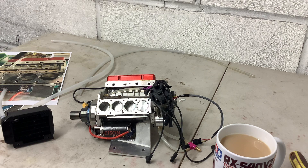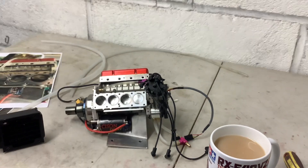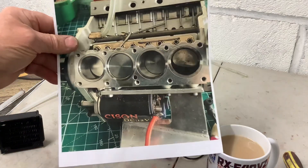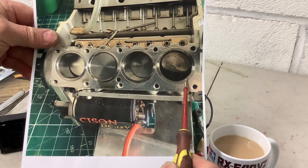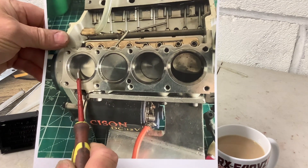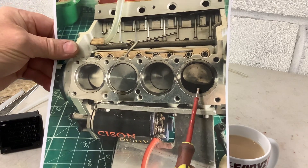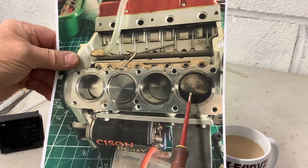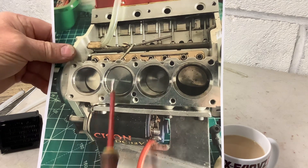It was just smoking like mad on this side. So I took the head off to see what was going on, and as you can see in this picture, I believe this is number two cylinder and number eight — both were full of oil. Two cylinders full of oil, no wonder it was smoking. That's how much oil was in there. These ones don't seem too bad, but it was just chucking the oil out of those two cylinders.